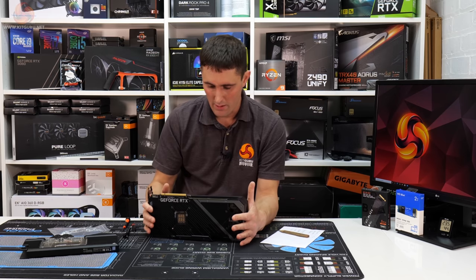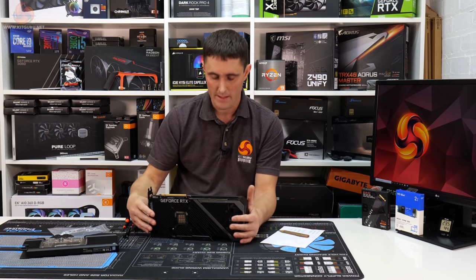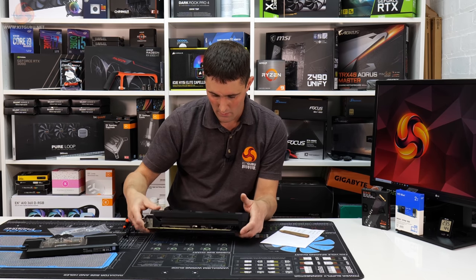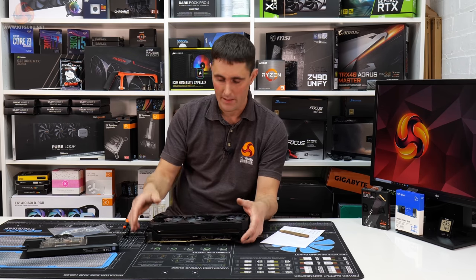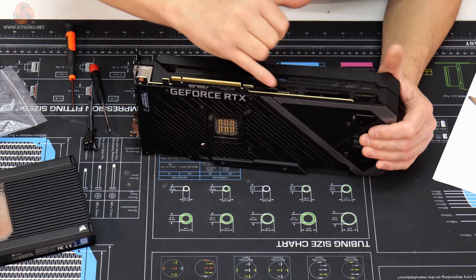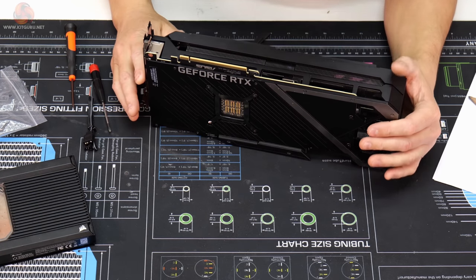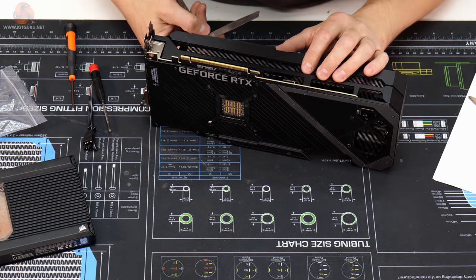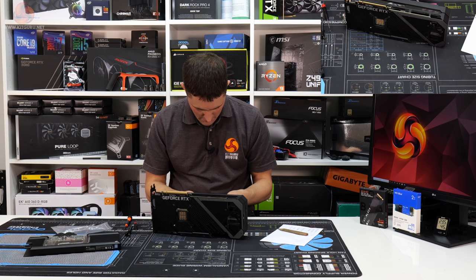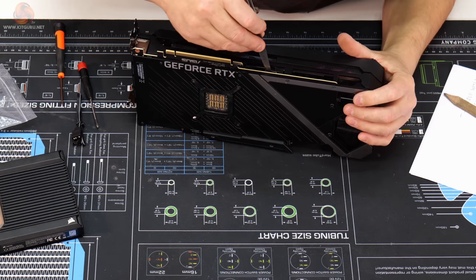When you put the thermal pads on and then put the screws in for the heatsink, it will compress the pads a little. So they're always a little bit big to begin with, and then they compress down when you put the cooler on. The only other thing really now on the front of the card is the inductor for the VRM, and that looks like quite a huge gap actually. So I'm going to start off at 2mm, so 0.7, 0.8 and 0.5 feeler gauge, and that goes in between there.